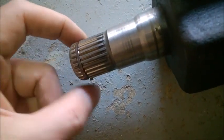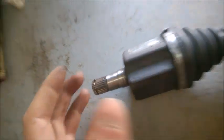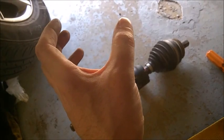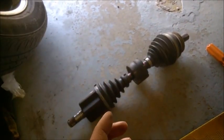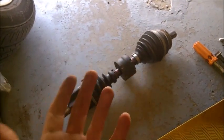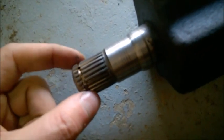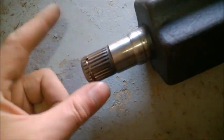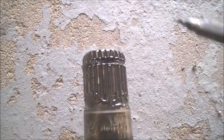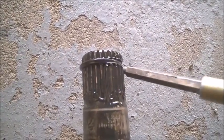This is the clip that sometimes gets stuck inside the transmission, and especially aftermarket ones will have the wrong size clip. If you get an aftermarket or used axle and try to push it into the transmission and it doesn't go in easily, don't force it — because if you get it stuck and need to replace it later, you won't be able to remove it. You can't replace just the clip because when you move it, it bends open. Be sure to grease the locking ring before installing the axle shaft into the transmission — it'll be easier to remove next time.